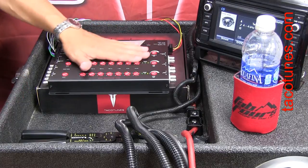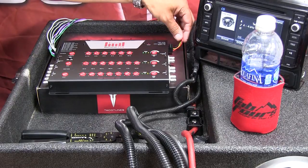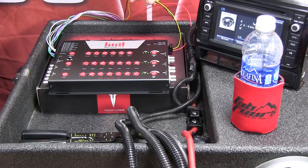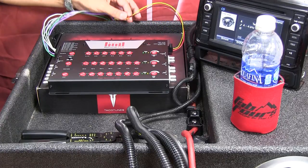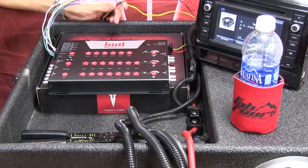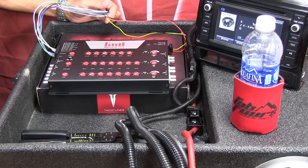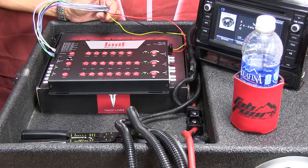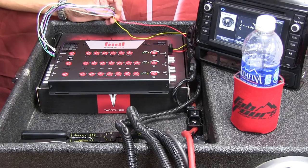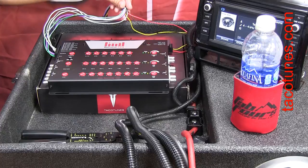The reason I like to wire this side in first is so I know these loose wires won't make contact with anything when I apply power. A little tip: I recommend never cutting your Recurve wiring, because a lot of times you'll make adjustments or changes to your system a year or two down the road. If you cut this wire you're going to limit yourself, and color-coded wire is not cheap at the auto parts store. I recommend hiding it — don't cut this wiring.